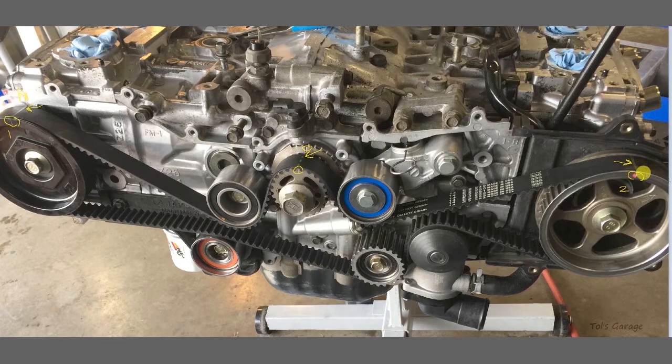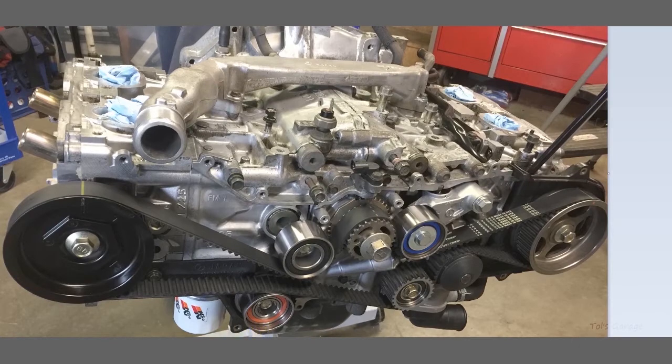The solid mark for cam sprocket number two will align with the timing mark on cam sprocket number two right here. Here's another picture giving a different view of the cams and the crankshaft properly lined up with the belt in position. This gives a really good view of cam sprocket number one — how the timing mark is aligned with the cam cap and the cylinder head matching surface, and how the solid painted line timing mark on the belt lines up with the mark on the cam sprocket. You can also see the dashed painted line matched to the timing mark on the crankshaft sprocket, and the solid painted line aligned with the timing mark on cam sprocket number two.